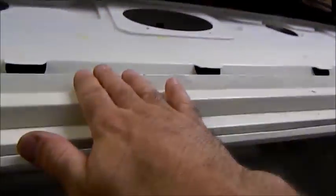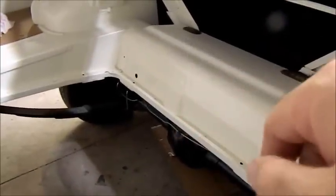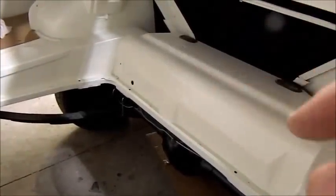I've got to fill the rear axle up. It's going to be easier in the boot here without the petrol tank in. So I can fit these trims up and fill the rear axle with oil. I'm going to change those rear springs because the ride height's just ridiculous on this thing. It's still far too high, and it won't settle to 4 inches or whatever it needs to. At that point I can put the rear shockers in. Then the fuel tank can go in, the spare, put the boot on, all that sort of stuff.